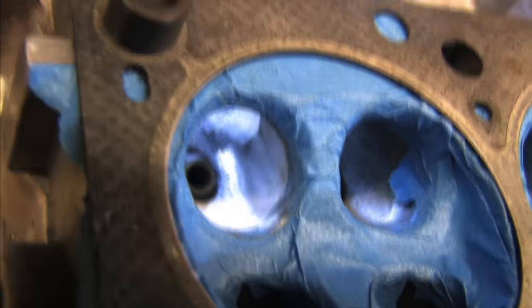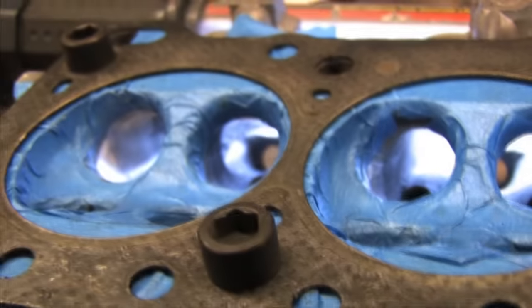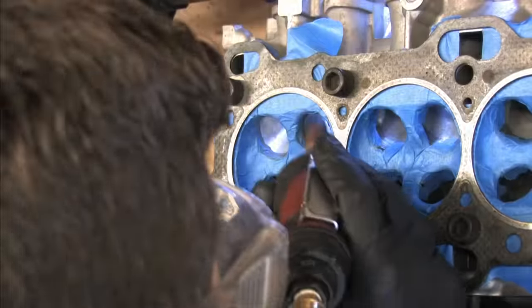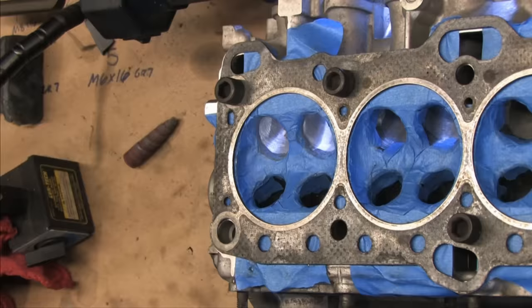I've got a little bit more to go here because any imperfections that are left in the surface after you're done with the 80 grit will remain throughout all of the other grits that follow. You want all of your shaping completed by the end of this cut. Being consistent from one port to the next is crucial on this job. So if you have to change the shape of something in one port, you have 7 more to do.